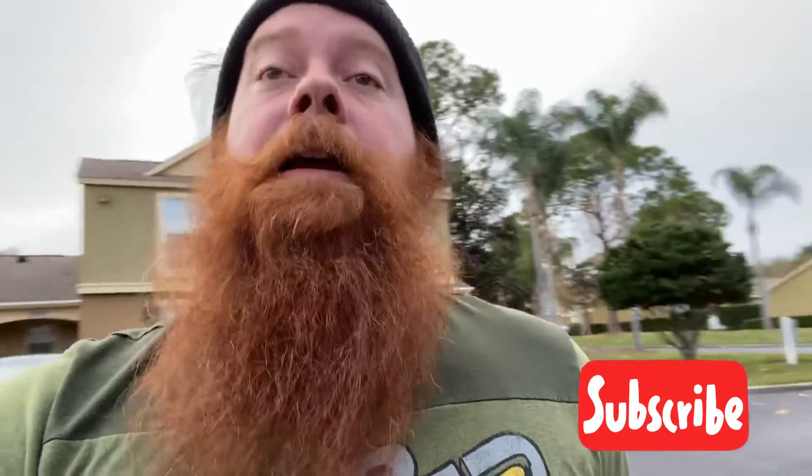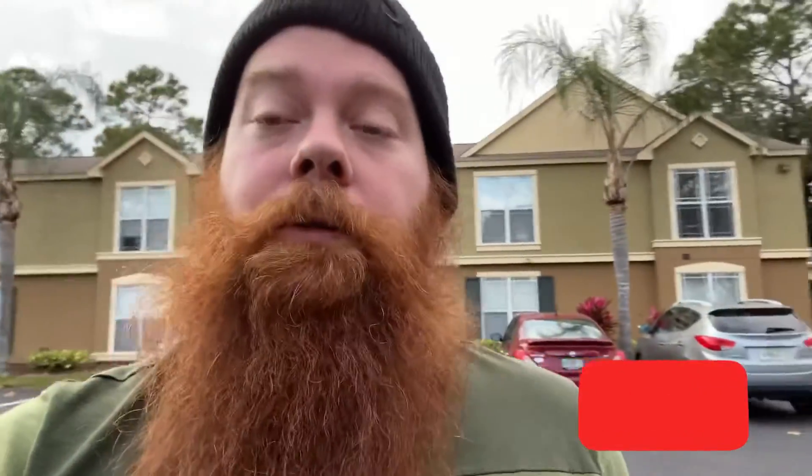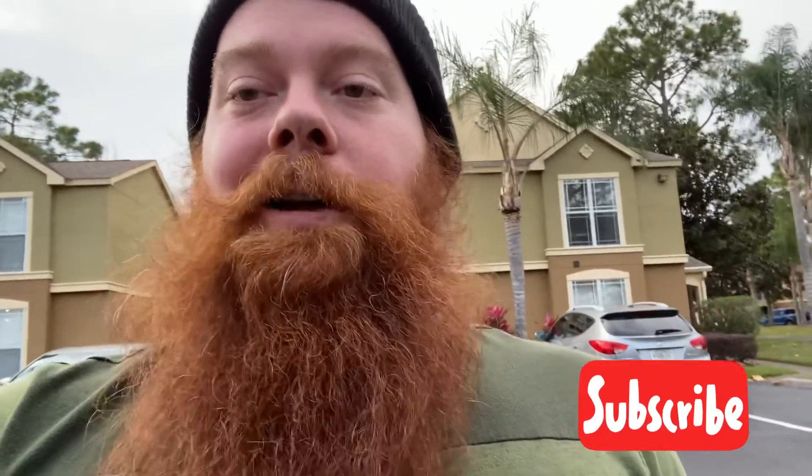It looks like that took care of everything. I'm going to monitor it over the next couple days while I drive it to work, make sure it's running fine and doesn't throw the check engine light again. With a coil pack, you're going to feel bumping, kind of like a chatter — the car will run rough. You can drive it but I wouldn't too much. Quick little fix: go to AutoZone, get a coil for like 35 bucks, pop it in, see if that takes care of it. If not, it's going to be your spark plug. Look forward to showing you an install video on my Crown Vic — it's down right now, I've got to replace some gaskets on the valve cover because it's leaking oil. This is Fedboy 99 Productions and I'll catch you guys in the next one.